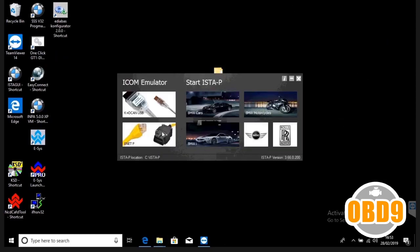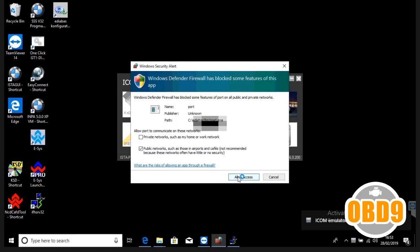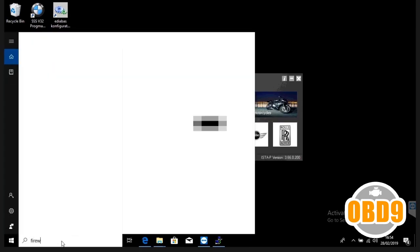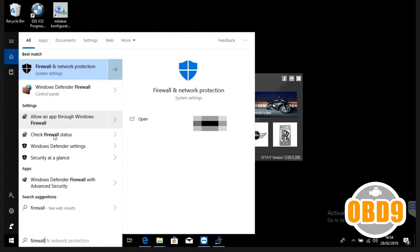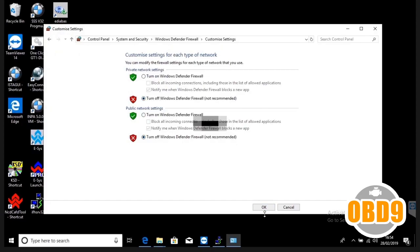Now start to connect to your BMW. Click on the adapter that you've got. In the right-hand side corner you're going to see your car's IP address — when the battery of your car is on, it will show the IP address and you type it into the box, for example something like 192.168.1.1 — it differs for every single car. Make sure your firewall is definitely turned off. Type firewall into your search bar, click check firewall status, click turn Windows Defender on or off, click turn off for all network types, and press OK.